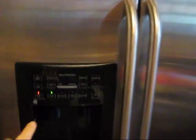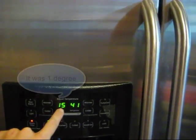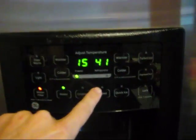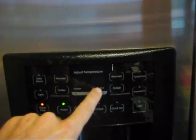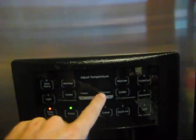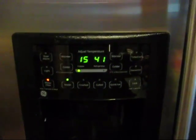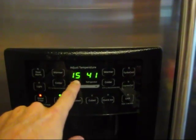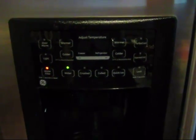Let's see what the temperature was. The freezer was at 3 degrees and now it's 15, so that's 12 degrees warmer. And the refrigerator is 41 degrees — my wife says it's typically 37 degrees, so that's 4 degrees warmer on the refrigerator side. We're still 17 degrees below freezing in the freezer, and still 41 degrees in the refrigerator, so that's still very, very usable.